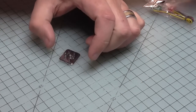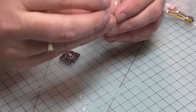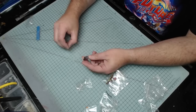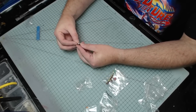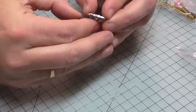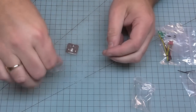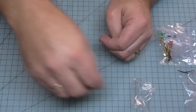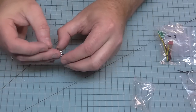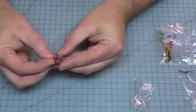We've got a lens to put in - it comes in its own pack. I've got three lenses here; these will diffuse the lights coming through, and it's the bigger one I want. I push that in - it's quite a tight fit but it fits lovely. Now we've got a turn lens - an indicator lens - with an arrow on it. Turn this over and it goes on top. We want the arrow pointing towards the left.